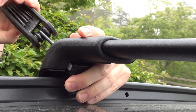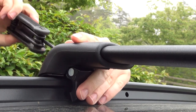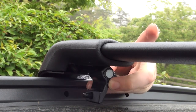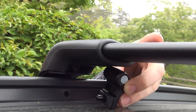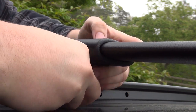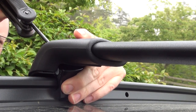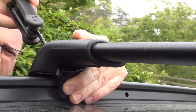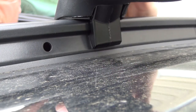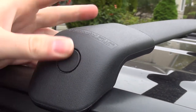It might come off — don't worry, it's okay. As you're screwing, it's going to create enough gap for this to slide on. You really want to make sure that this pin back here — this little notch — goes into one of these holes. That's really important. Once you put it in, wiggle it back and forth to make sure it's not going anywhere, then just retighten this star set screw, and you're done.